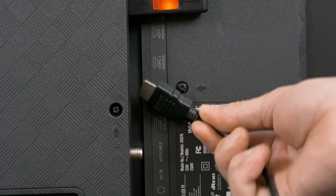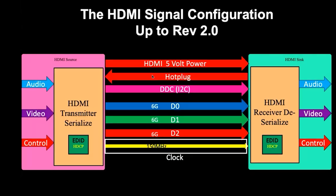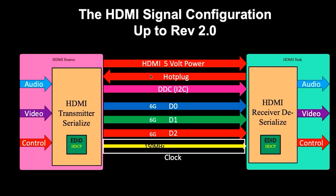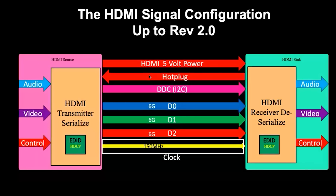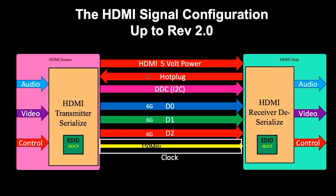Again, tragically oversimplified here, but that 5-volt channel up top has to negotiate a very specific milliamperage between a source — like an Xbox Series X — and a receiver, like a TV or an AV receiver, just to get the party started. And if this one little thing doesn't happen, then nothing happens. While that trigger went off fairly successfully in the past, it's now getting more and more difficult to do. Then on the other side of this diagram is a clock. Without getting into what the clock actually does, it's like air traffic control in a way. If that clock can't do its job, forget it — party's over. You could be looking at failure, which means no audio or video signal to your TV or AV receiver.